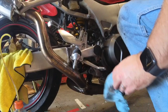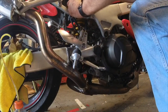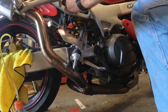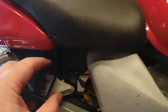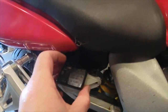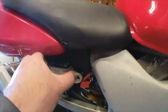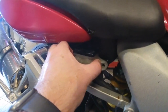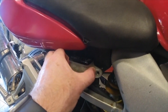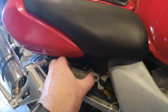Now take a quick look around — make sure you didn't drip brake fluid on anything. If you did, wipe it off real good and maybe hit it with some brake cleaner, because it will eat your paint off. There's a little plastic notch here — that notch slides back into a hole there. Hold it in place and put the bolt in that holds it. That's how you do your rear brake fluid. Hope you like it — please like, subscribe, and get out and ride. Thanks.